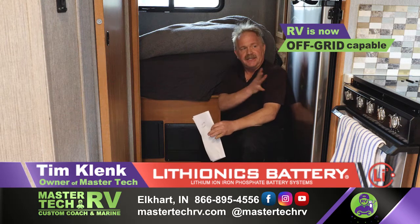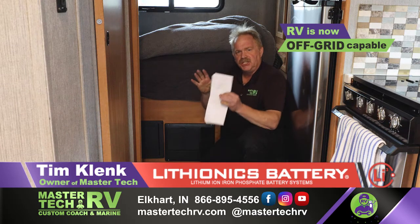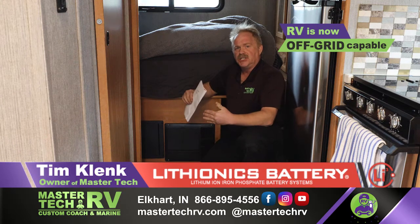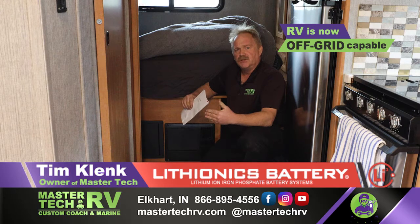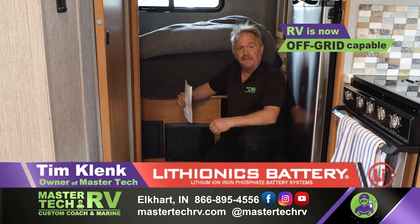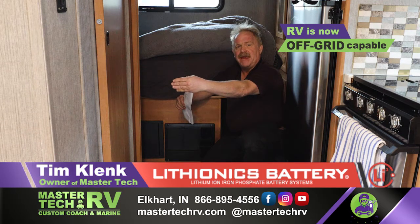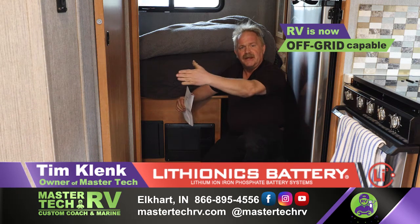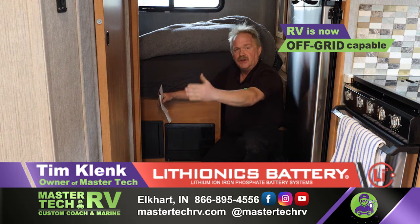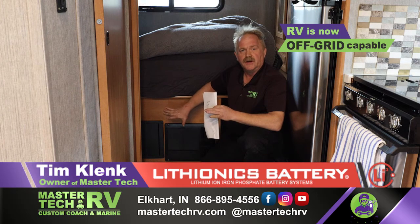This coach originally had a 110-volt refrigerator and a 1,000-watt inverter in the back that just ran the refrigerator. Under any inverter installation, the inverter should be within 10 feet of its power source — the battery system. So in our integration we relocated the inverter system up to the front bay just behind the entrance door and wall-mounted it. Then we run the proper-size wiring from the distribution to the inverter and from the inverter back to the secondary distribution for all inverter devices.